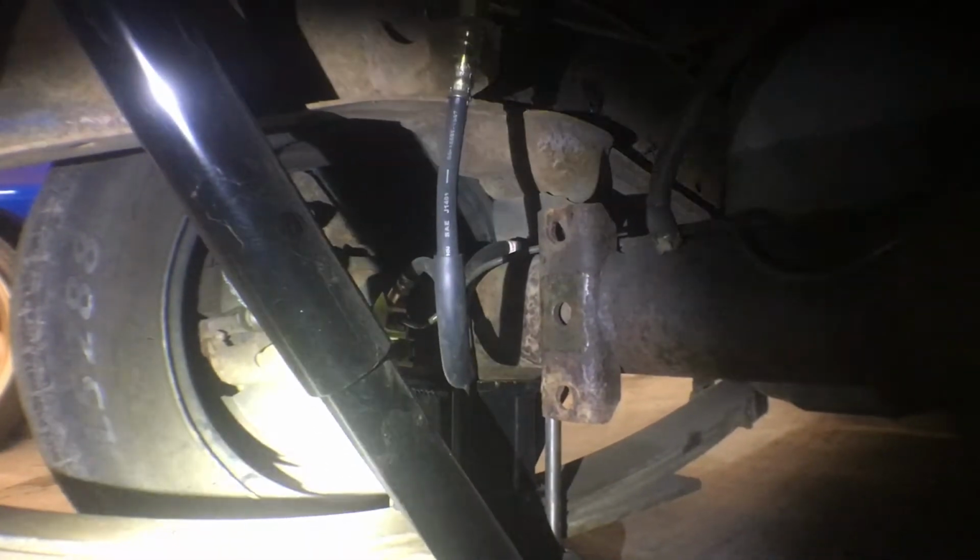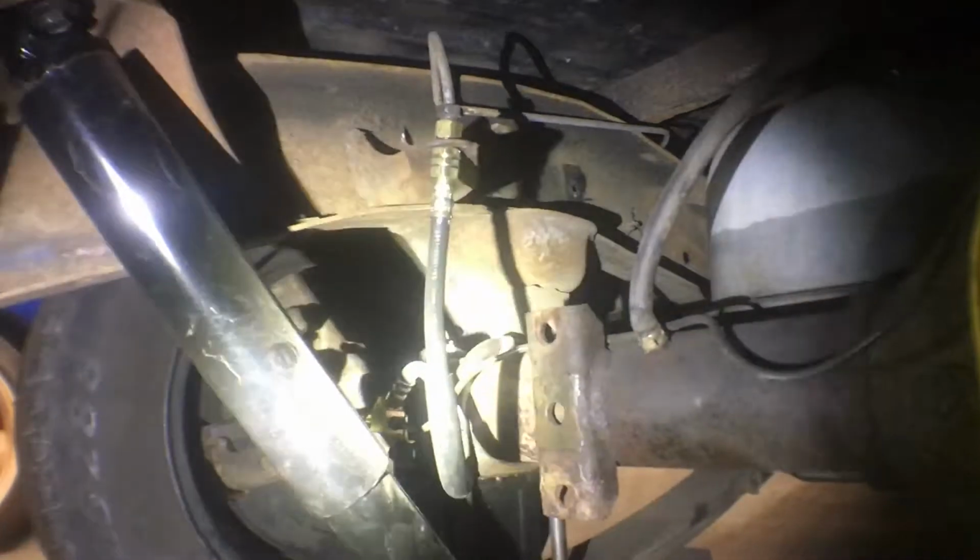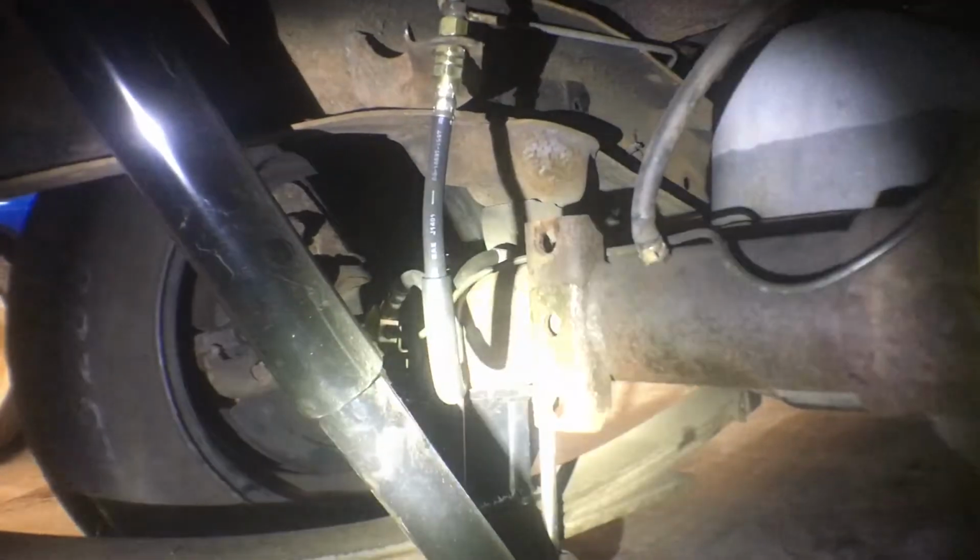It's tapered, and we got longer U-bolts. U-bolts are 3 1/4 inches to go over the axle tube, and they're 12 5/8 long. I got them from uboltsdirect.com. I think they're like $60 with all the hardware, nuts, washers, everything. Same with this side. Nice powder coated blocks I got off eBay. They were like $30 or something. And I don't know if you can see it, the drive shaft angle hasn't really been affected too much. So let me weasel out of here.